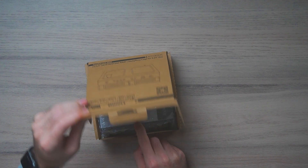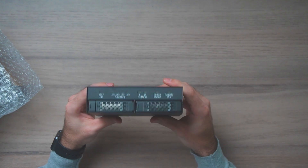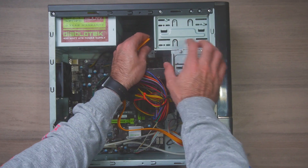Internal, external, SATA, SAS, NVMe - if you can think of it, it probably exists in IcyDock's store. I'll leave a link below to their Amazon page. The unboxing experience wasn't anything to write home about - you get an instructions manual, the actual device, and some screws. To connect this to your system you'll use standard SATA power and data connectors, so you can connect it to pretty much any system from the last decade or two.